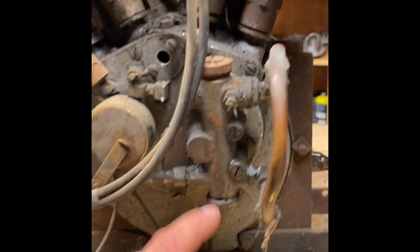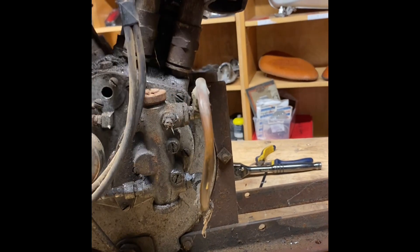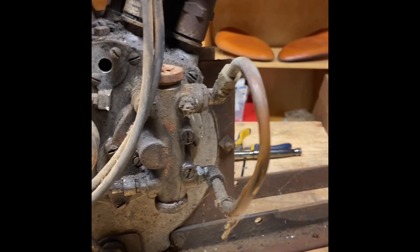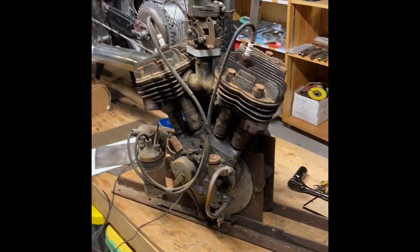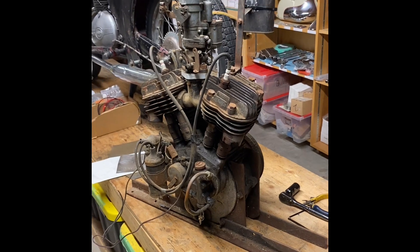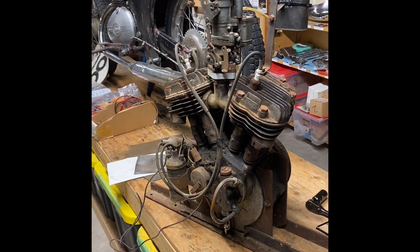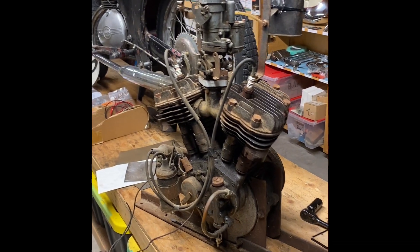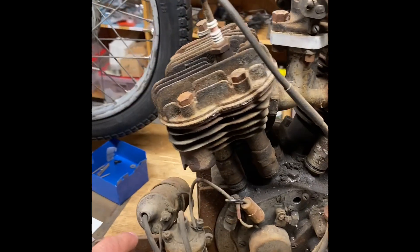The oil pump has been redirected into itself. I'm not sure if they had a different oil tank at some point, but one port should be the feed and one the return — they just bypassed it and looped it. That probably wouldn't be great for heat since it's air-cooled and not getting airflow past it. The oil would have helped cool it too, and you're just recirculating it back into the bottom end. It all depends how hard you're running it.